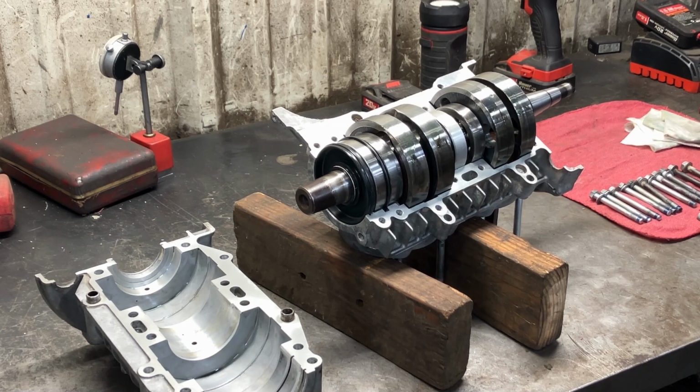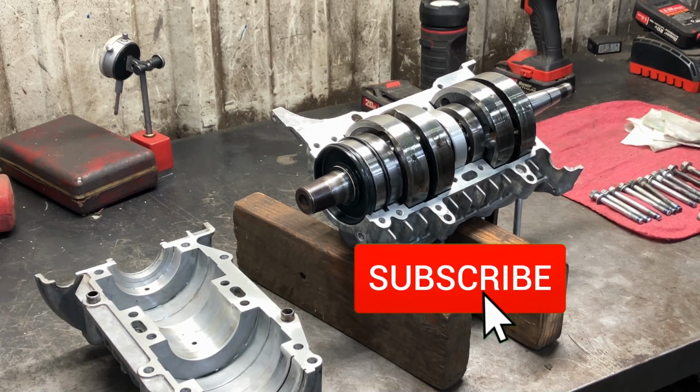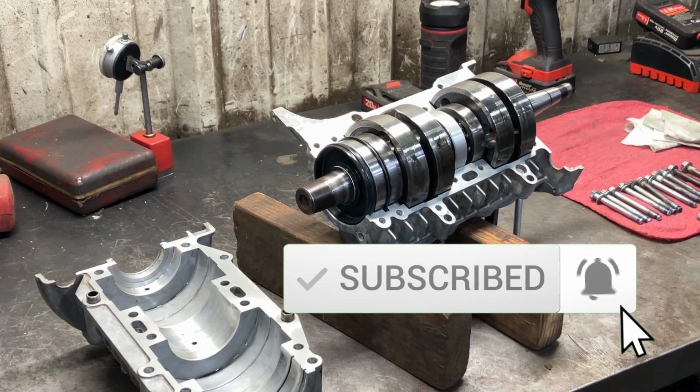Everything's been cleaned in the parts washer. You're always going to want to make sure you clean the base gasket remnants off the top half of the crankcase. Saves you some time. If you do it now, you don't have to drop parts of the gasket material down in the new bottom end that you just put together.